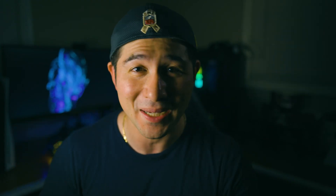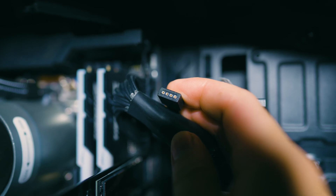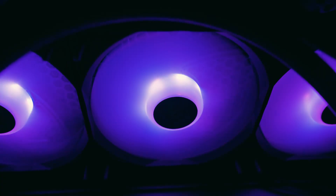Let's now talk about the difference between RGBs and ARGBs. This is actually very important to know because they are different in every single way. RGB, exactly how it sounds, is a more affordable header and cheaper for manufacturers to produce. RGB headers have four pins, which equals out to 12 volts, and are not addressable — which is just a fancy way of saying that these lights work in a series. Therefore, you cannot create multiple colors out of regular RGBs. RGBs have four different pins: one is 12 volt, one is G, one is R, and one is B — the combinations you need to create those beautiful lights.